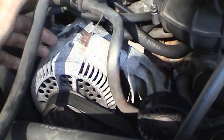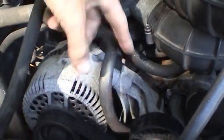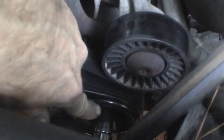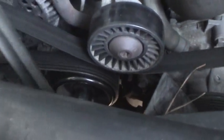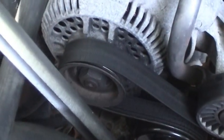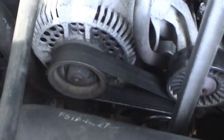You could actually put that larger alternator in this truck because you have some space between the alternator and the bracket, but no need to do that with this truck — 95 amps is plenty and it's running really good. To get the belt off, you've got a tensioner here with a bolt on the end of it. You take a big breaker bar and move it this way to release the tension. It's going to take two hands so I can't get the belt off while holding a camera, but you get the idea — once the tension's released, you can go ahead and work the belt off.